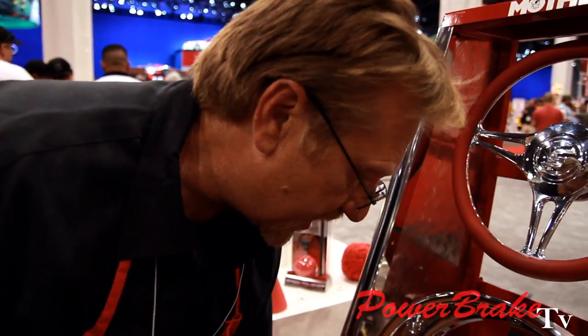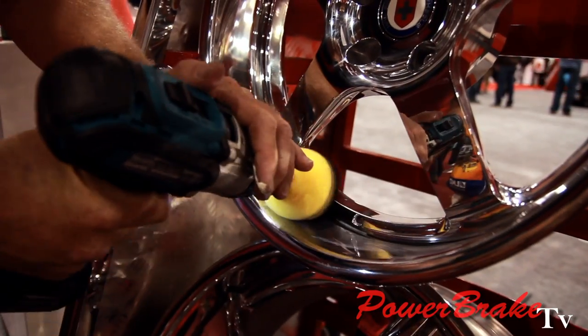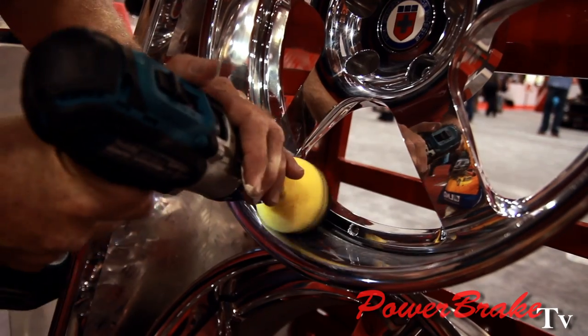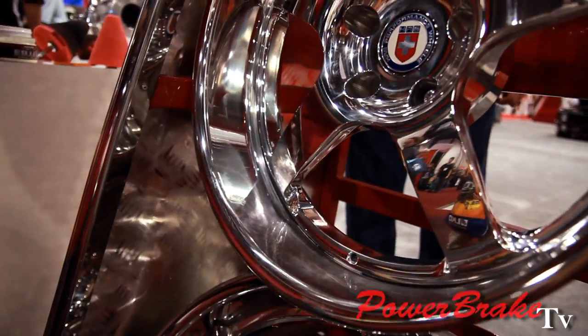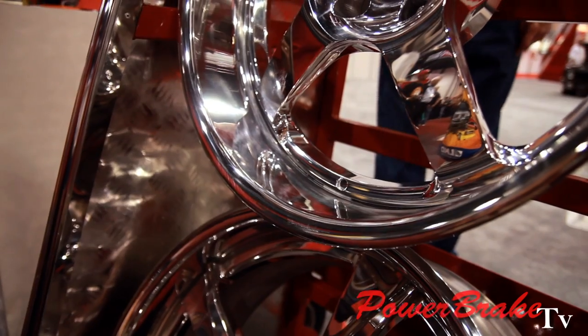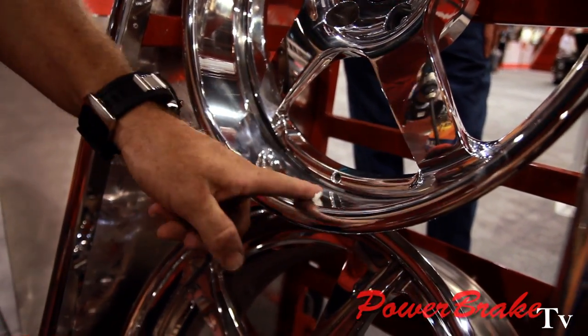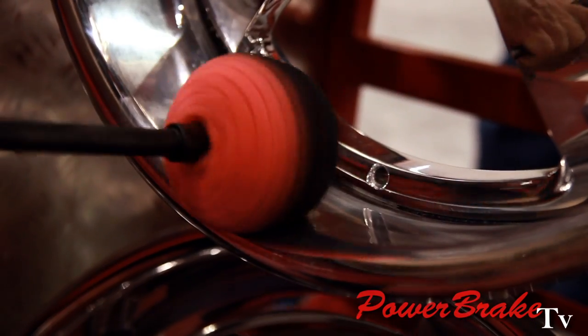If you see some more rashing or didn't quite get where you needed to, always go back to stage one and re-polish. Sometimes it takes a couple of times to get your desired shine. A little product goes a long way — you can do about half a wheel at a time. Always use a microfiber, wipe, and bring it to a nice shine. Then take your finishing Powerball with your billet polish, put a little bit on, and it'll bring you to your desired finish. Make sure you get all the edges nice and even for a very nice, even shine. Take your microfiber and polish that to a finish.